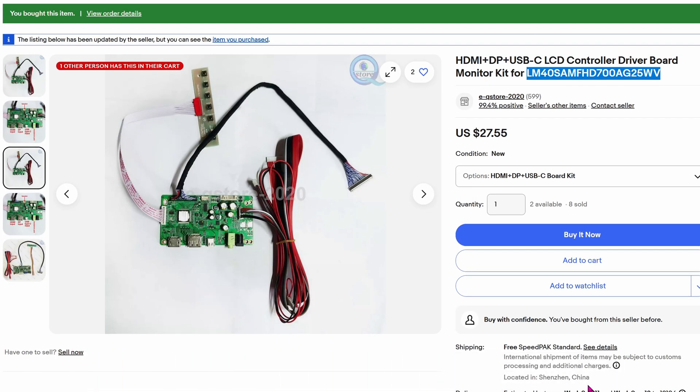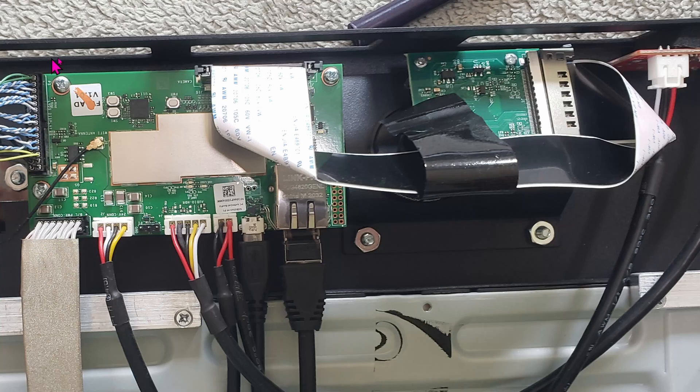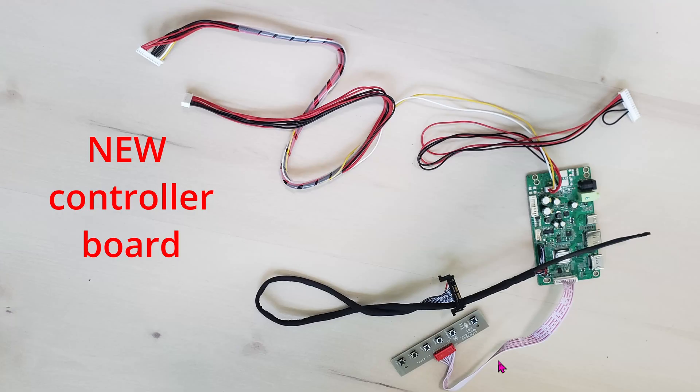Shipping is pretty fast if you're in the United States — I know it says Shenzhen, China, but it arrives within about one week. On the top of the mirror you should see the controller board with a bunch of wires going into it. This whole board is useless, so go ahead and start disconnecting everything. The camera module is right here — disconnect that as well. When you remove the camera, there will be a big gaping hole; be sure to use blackout tape like electrical tape to cover it up so it won't distract you later on.